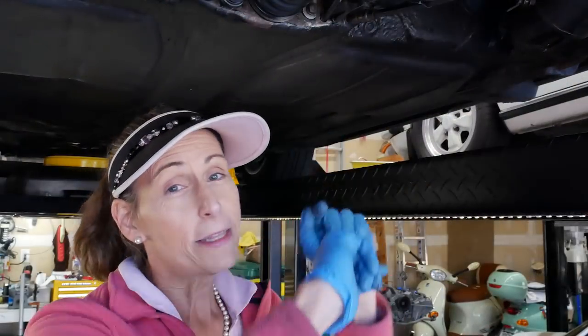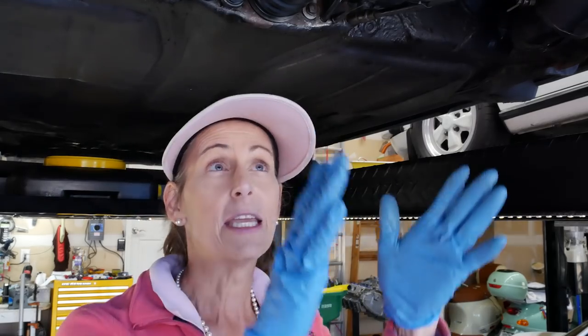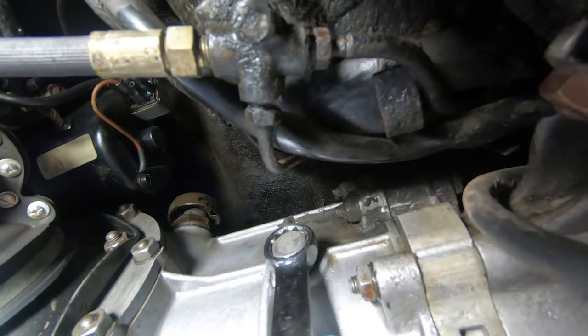Well, woohoo! I think our seal is holding great. Our JB Weld worked exactly as I had hoped it would. I went out and shifted a ton, and it's completely dry. So, yay! Super awesome. All right, believe it or not, that leaves only one more task, and that is to drain and refill the entire transmission fluid.